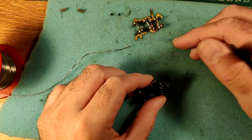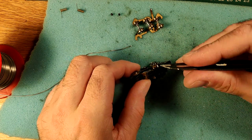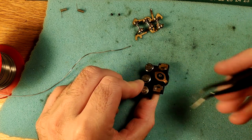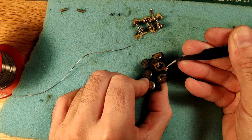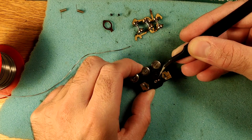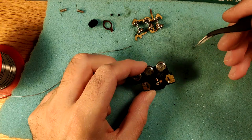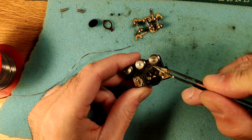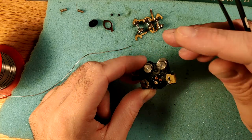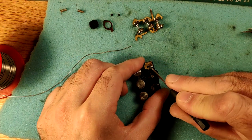Next thing is on the back here, which I don't think is clipped in. You've got to slightly alleviate it from there, lift it up, and it should slide out and then up. So that'll be another thing to clean. This gear should come off all right. Not the easiest, actually. The rest of that stuff at the bottom, that gear and these wheels, I'm just going to drop the whole thing in a pot of fluid and clean it, just to get the main deposits out. Now, what we have to do though is this. We'll start at the back.